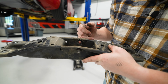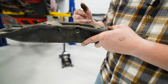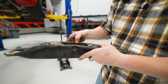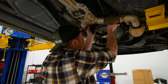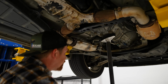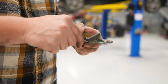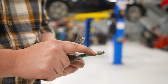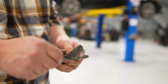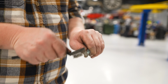So this is that dowel we were talking about. The bolt kind of slides in through this, so as you try to pull it down, it's gonna hit. You have to kind of push it up and then wrap around, and then you can get it off. Boom. If you had a bolt, you know it was being a pain. And there's all this kind of white corrosion, old Loctite kind of stuff on there. Take a wire brush and make sure you clean that guy out.